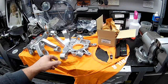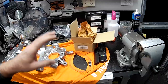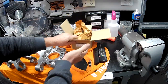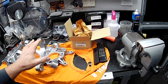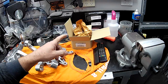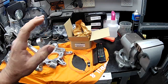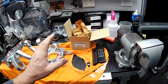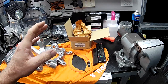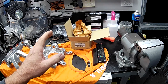So what I'm about to do is rebuild these rear hubs. I have all the new bushings to press into them, all the new wheel bearings and hubs — all genuine stuff. All the bushings going in are going to be spherical bushings. The first thing I'm going to do is press the hubs into the rear wheel bearings. The hubs are currently chilling out in the freezer inside the house, so I'll set up over at the press and go get them.